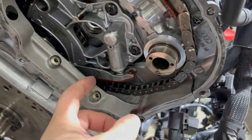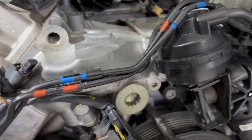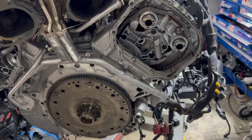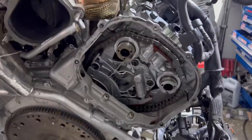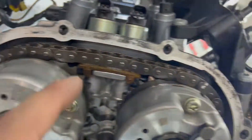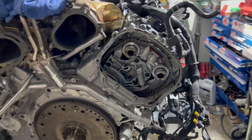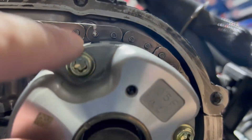Put it on the camshaft hand tight. Release the tensioner, set everything to the timing, make sure the crankshaft is set at top dead center, hand tight. Then torque it — I'm doing 95 newton-meters and then 90 degrees. I've already set this one — it's perfect, that's how the specs show it, nice and tight. Now for this one: I set the exhaust cam with the side of the groove over there. Intake should be between the middle and the right corner.